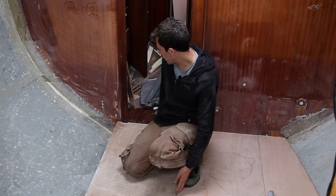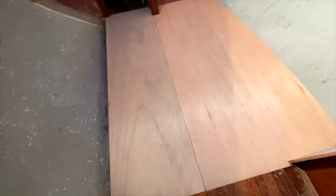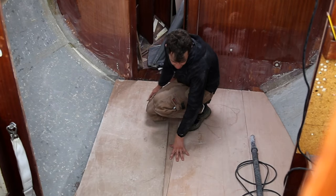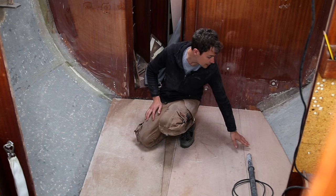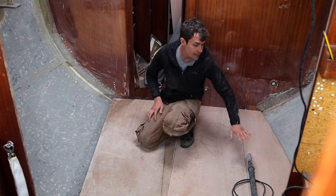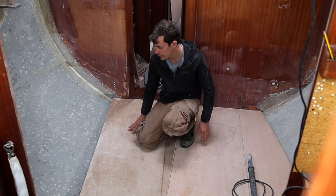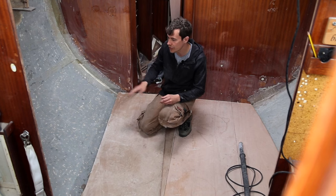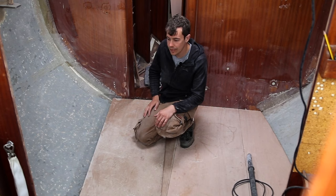As you can see, I've actually got three pieces of flooring down now. This is just the port side edging that I need to put into place. These two are in position and are fully braced underneath. The starboard side piece has been contoured to the hull and is resting — it's not quite secure just yet, it needs a few more braces underneath. Today I'm going to be working on the port side hull piece. I'm going to get this piece into place, cut it, then all the floor is going to come up. I'll give it a good sand and a good clean, ready for paint.